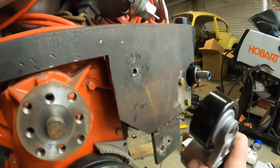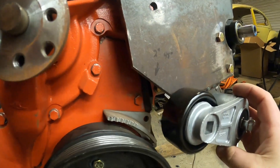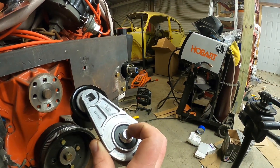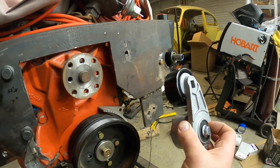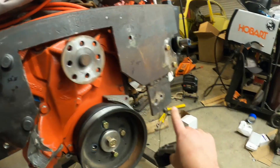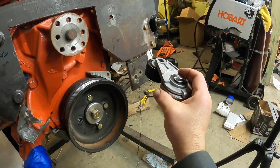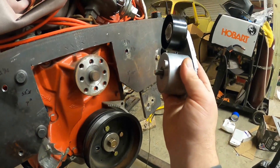One last thought on my tensioner pulley — I was looking at it and I might still change it, re-drill it, and move it down. But it seems to be holding the belt pretty well. The part number is a Gates 39371, comes off a late-2000s to early-2010s Chevy pickup I think with a 5.7. For the bolt hole, all I did was measure 45 degrees off of both corners, center punched it, and drilled it. I had to go buy a metric bolt for it — it's an M10 by 1.50. Same as these pulleys, just a longer version.